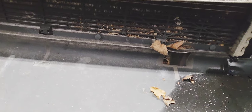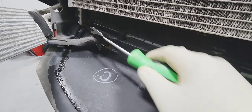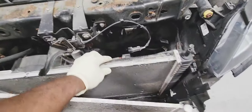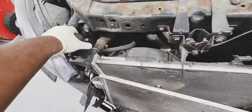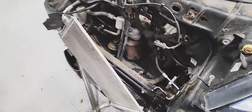Now we're going to remove those push pins that hold the lower part of the bumper — there are about six of them. Now everything is loose. Let's take our radiator out. We can leave the condenser hanging like this. Remember to put those insulation pieces back in the frame.